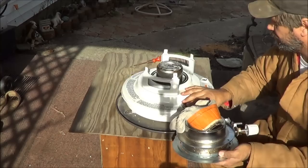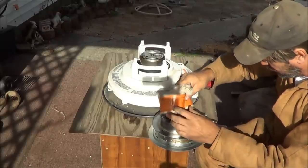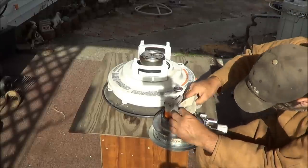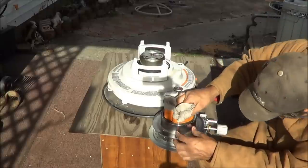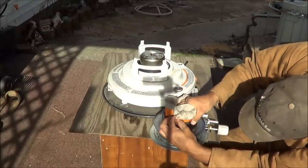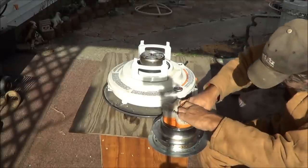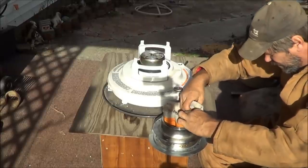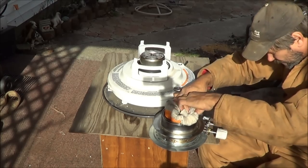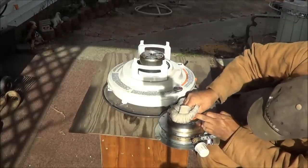For your new wick, you're just going to want to get your wick down in there. I just get it kind of halfway straight in there, and then I'll pick a spot on the side and stick it right there where the line is, and then I'll kind of work myself around. You want to kind of stretch it and make sure you get it over those pegs so you don't get any wrinkles in it all the way around.